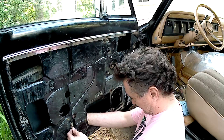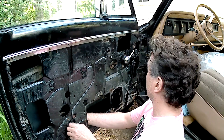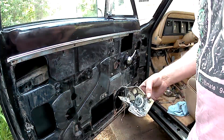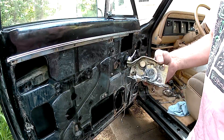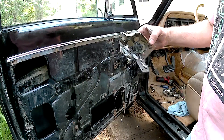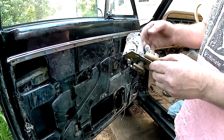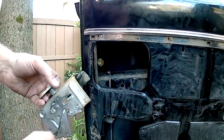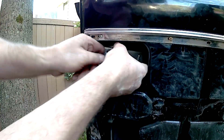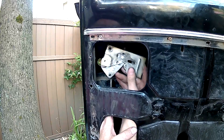The only thing left now is the latching mechanism and then the water shield, and everything just goes back on. Off camera I cleaned up this latching mechanism — I scrubbed out all the old dried lithium and dust combination that had been in there and coated the moving parts and contact surfaces with fresh lithium. The procedure is going to be: install this in the door in this direction after hooking this lock rod to it. First thing to do, I'm going to connect that lock rod to this. The best way to do that is like that.